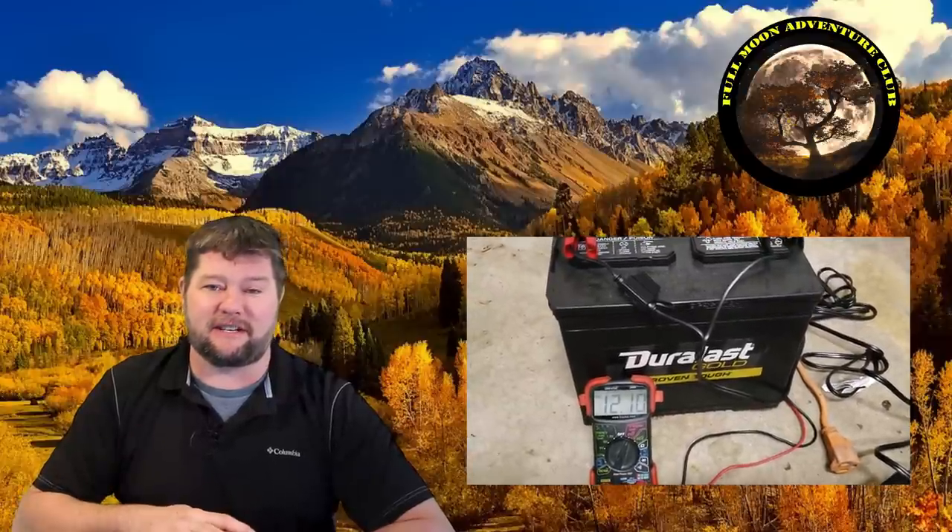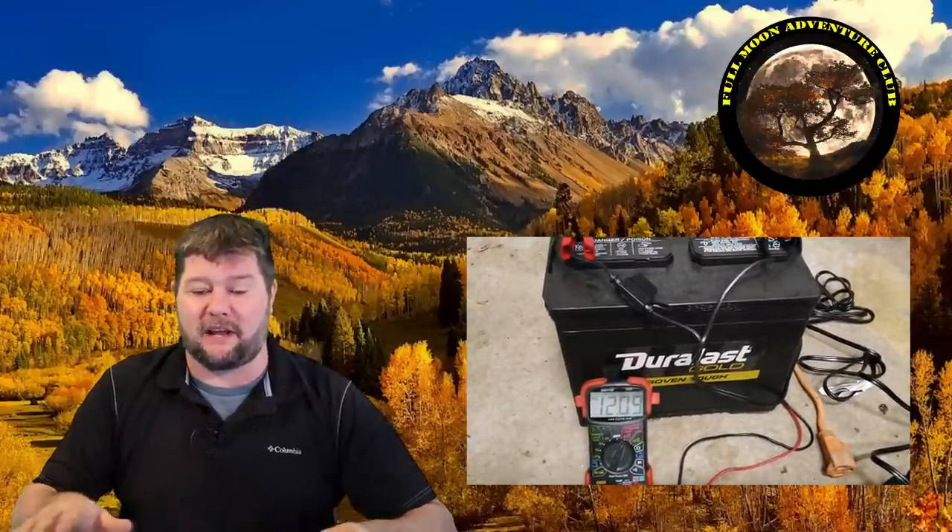That is a toast battery — it's probably starting to sulfate and is in super bad shape. Under two volts is crazy, that thing is deader than a doornail. Not easy to get a battery down that low. After about 40 minutes on the Battery Tender it was back up to over 12 volts, but when I pulled it off the voltage would kind of start to drop, because that battery is going to take a day or two to really equalize and see if it's worth saving.